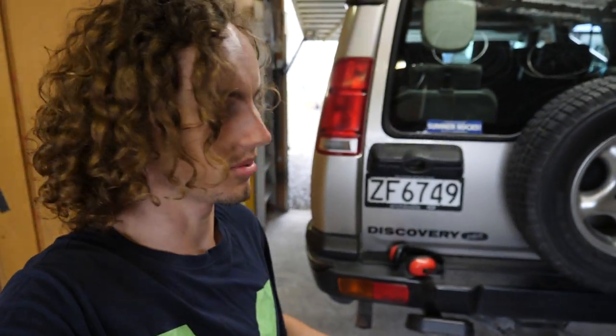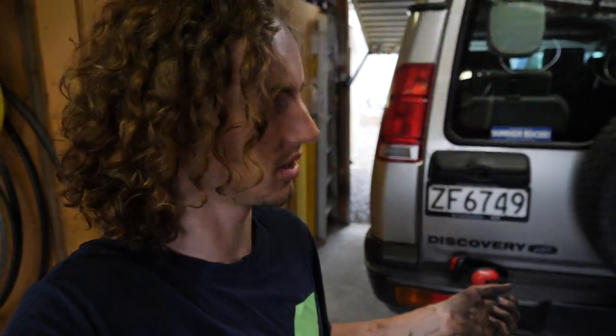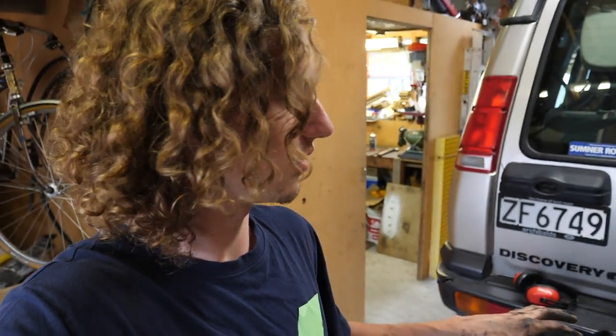Springs out, the axle's dropped all the way down. It actually didn't go much further, so if you're doing this yourself, I wouldn't bother about releasing the brake lines and the ABS cables, because the bushes in the Watts linkage and a couple of the other bushes, like the sway bars, the end links, they don't allow for much more droop. So if you're gonna do it, you'd have to remove that all anyway to get much more advantage over removing it. But yeah, just drop those shocks off and you'll get enough down travel to pop the springs out.